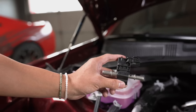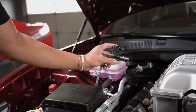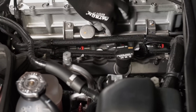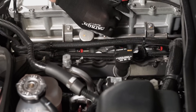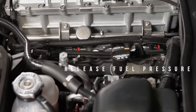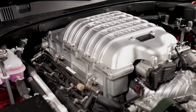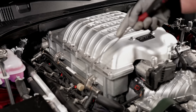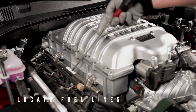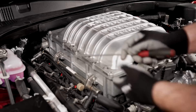The main purpose of the ethanol sensor is to track the ethanol content blend in the fuel. Because we're installing the ethanol sensor to the fuel line, on these Hellcats you must release the relief pressure valve — this depressurizes the fuel in the system. Now that the fuel system has been depressurized, it's time to locate the fuel line. Best way to locate it is to follow the fuel rail. On these Hellcats, it's going to be on the passenger side.